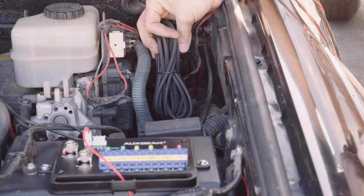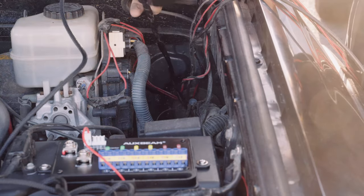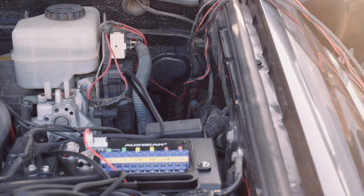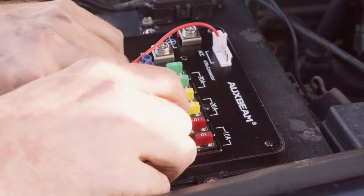I usually stretch out a wire clothes hanger and tape my cable to it and poke the straightened wire hanger through a boot in the firewall. In this case, I was doing some other rewiring and was able to use some pre-run wire to pull the new one through.